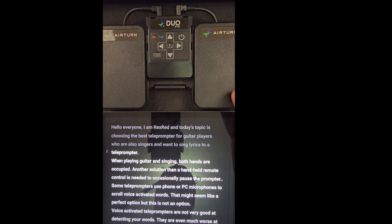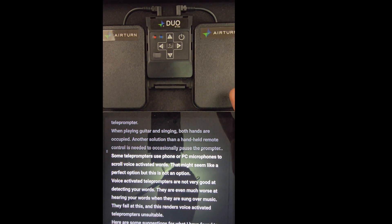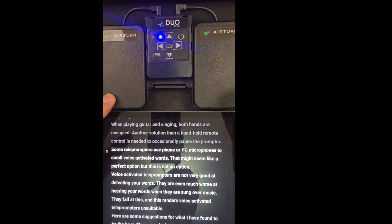I set the text size and speed before I place the tablet in the newer hardware. If you are left-handed or left-footed, you might want to switch the pedals. If you make a mistake and the Elegant Teleprompter says you have already used a keyboard switch key, go back to the Duo Manager and pick a different key for that switch, remember to save it again, then go back to the Elegant Teleprompter settings and try to input the switch again. Eventually you will get it.